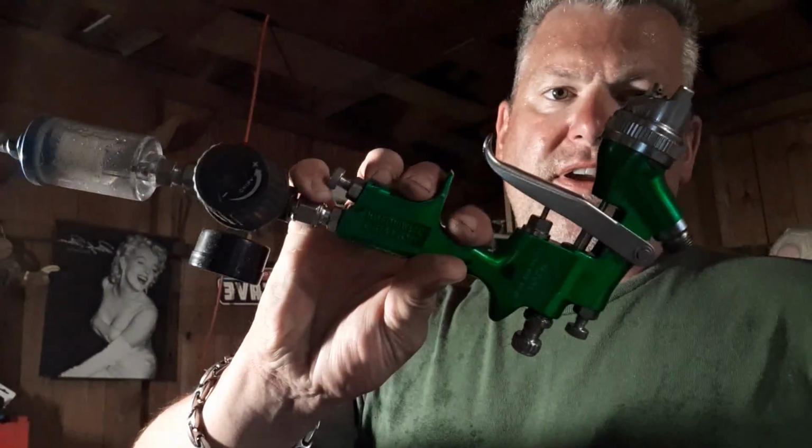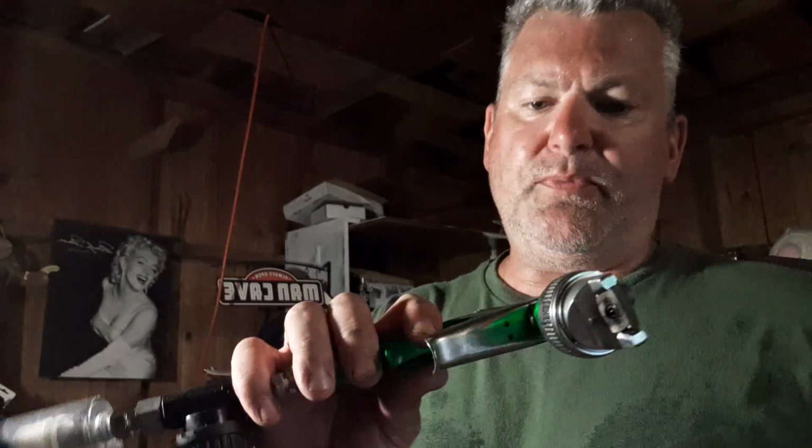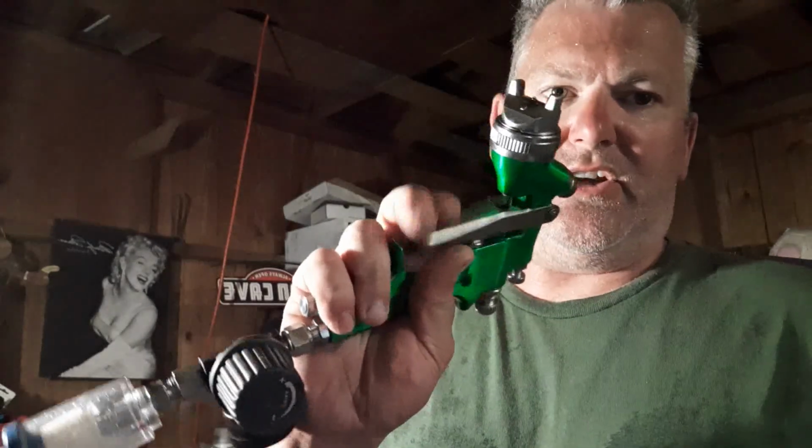Anyway, so today, something a little different. Since we sprayed a lot, and I did booger up the last paint job a little bit, I do a lot of wet sanding. A lot of that could be because your actual spray gun is dirty. So I'm going to give a quick rundown of how to tear it apart and how to clean it. At this point, we already sprayed acetone through the gun, so we cleaned out the majority of the residue that's left in there.